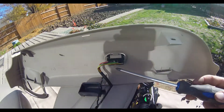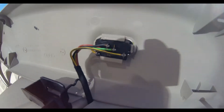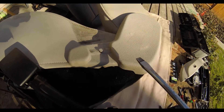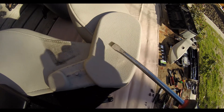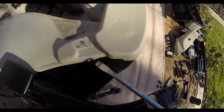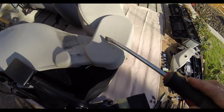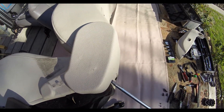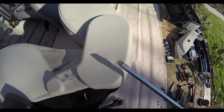This one pops out from here, this one pops out from here, and then you have to clip here and here — that's how you take out the controller for the heating elements. These are tricky to take off. First of all, you won't even recognize that these are pull-out items. You have to wiggle them from the bottom. I'll use something to get underneath there to press it out a little bit so I can pull them from this end.